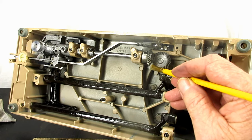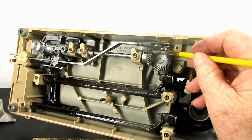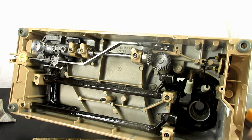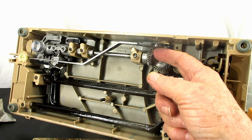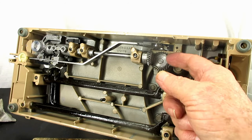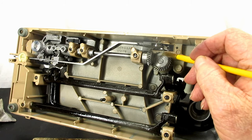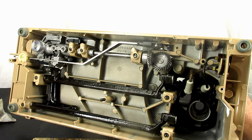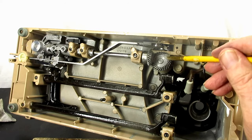and it's not going to be protecting your gears. These gears get very hot, even if they're greased perfectly. This grease can take some very high temperatures, but I will tell you, those gears get hot. So we need good grease protection on there. And I would do this a couple times a year. See how it's poking up now? See how it tends to come down to this point right here, and it's kind of being pushed down like that. That's real normal, so I'll just turn it a few times and spread it around some more. And turn it some more. And here we see it clinging to the edge, getting pushed out.